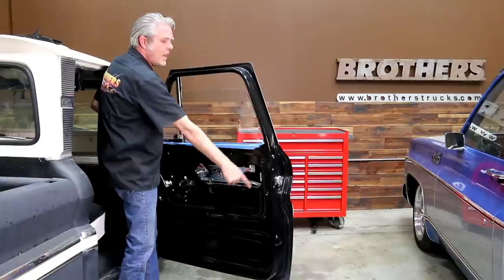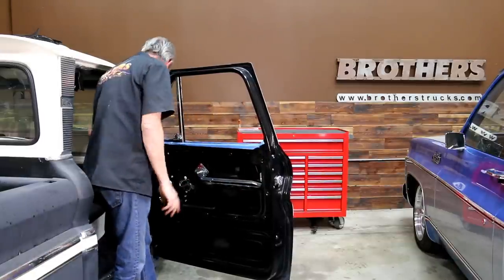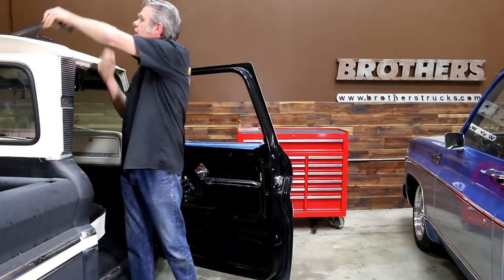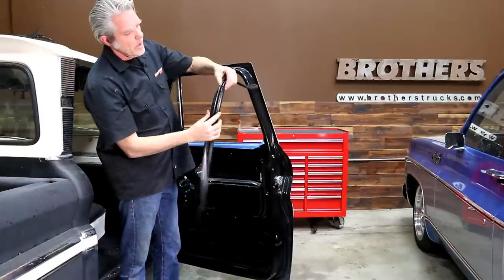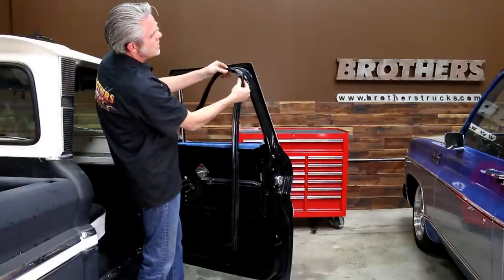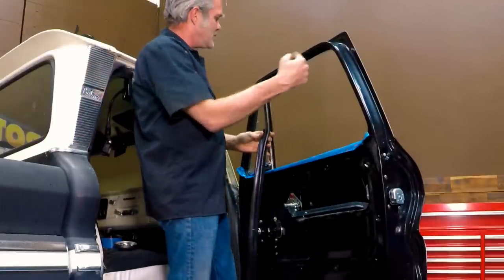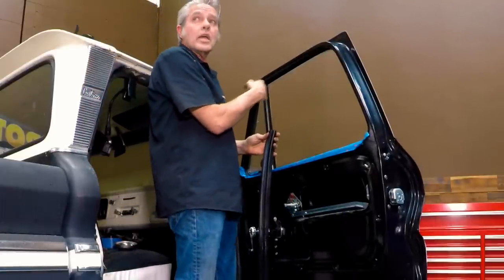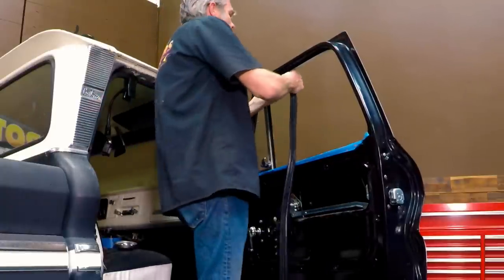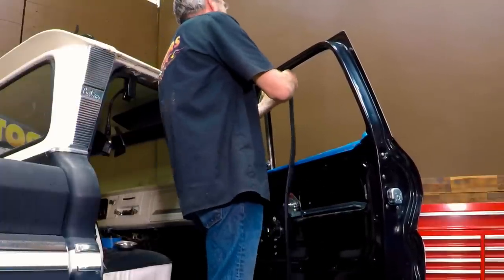When I do that I'm going to put my back one in first. We'll roll our window all the way down. You're going to want to notice on this rubber that it has these serrations — those cuts make it so this bends nice and easy in the corner. You're going to want to make sure that this piece is butted up all the way against this. A lot of times you'll get a gap right here and that's going to cause a whistling noise. So we'll really jam it up towards the front and make sure we're getting good contact there.